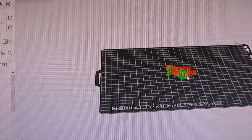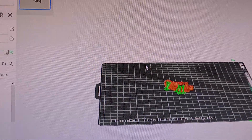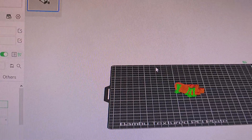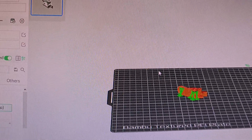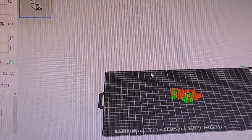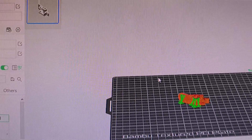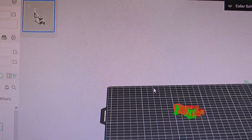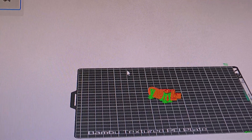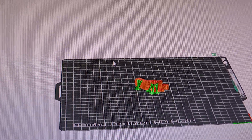I'm probably going to go ahead and print two of them out. But anyway, if you run into the problem to where nothing you do seems to get the lines right on your table, it could be that your filament's not being pressed onto the plate right. If you're adjusting your Z axis and it doesn't seem to be changing anything, then give your filament a tug and see if it's got enough tension on it. If you adjust that set screw that's in the back of the head and you can't get it to tighten up anymore, more than likely this part here is broke. So just a heads up for all you Elegoo Neptune users.